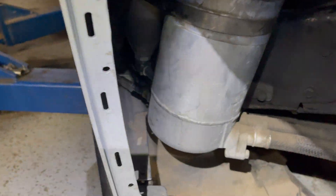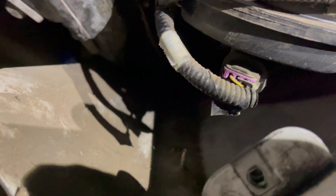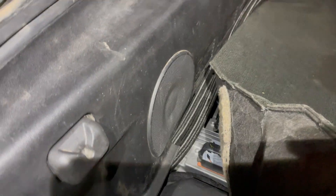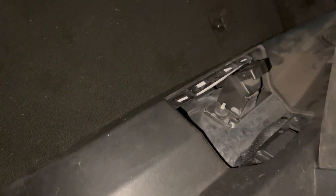These dash-12 lines run down through the body — you can see they come down next to the dry sump container here, then they run through the body of the car, and they come out on the back side of the fender and shoot up in through the car. I was test fitting the interior, seeing if I needed to trim the back panel or the carpet with the rest of the interior in place.